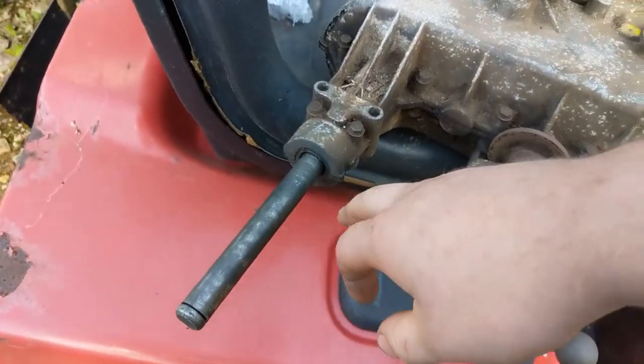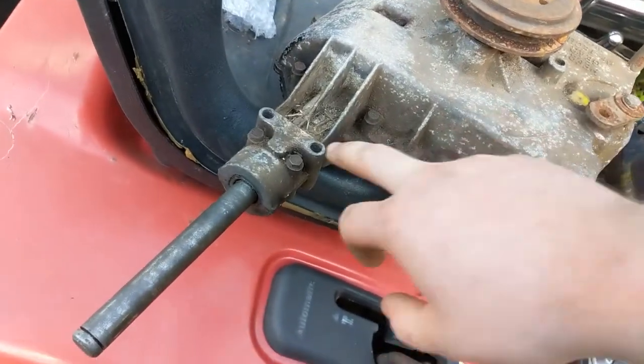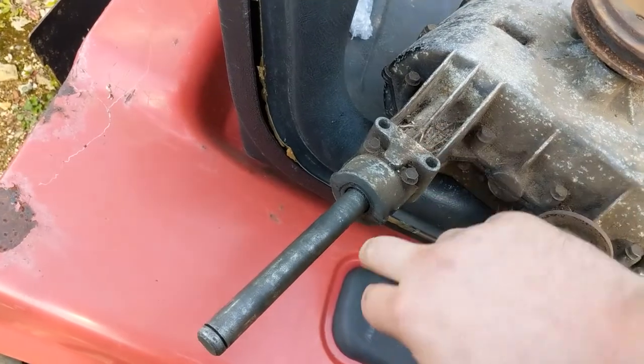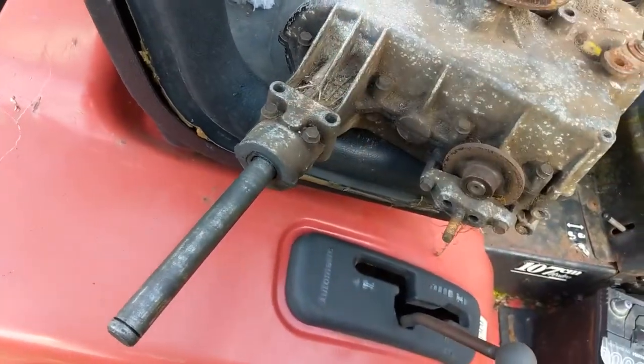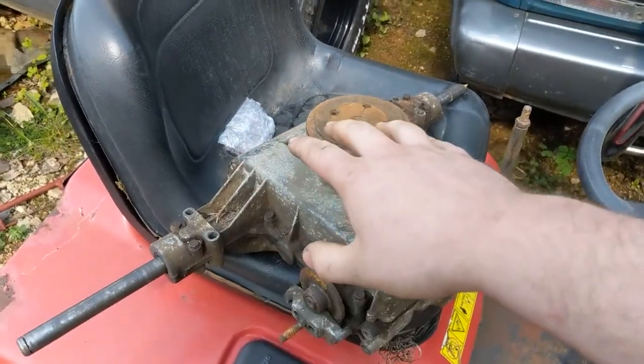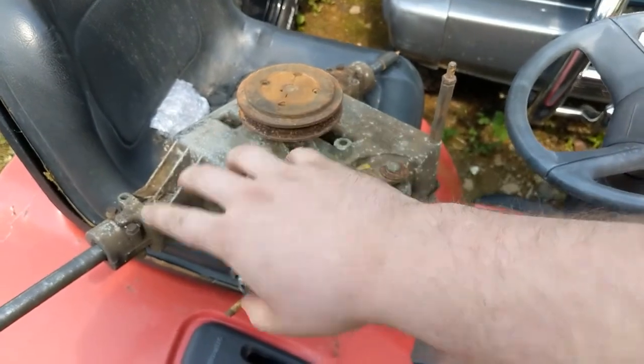My plan is - I've had one of these apart before and I've been looking at pictures - I'm pretty sure I can fit inch shafts into the casing pretty easily. I'll have to bore out some of the holes just a little bit, but then I should be able to just run a solid shaft all the way through and just weld it to the crown gear.